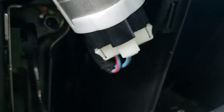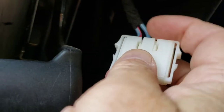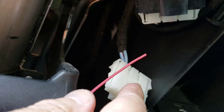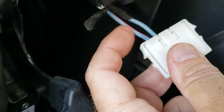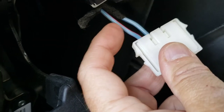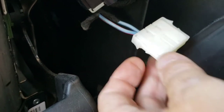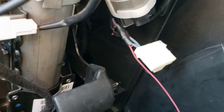For the ignition I have to unclip it. I'm looking for two wires — a blue wire and a blue-and-red wire. I need the blue-and-red; I need to solder this one onto it. The hardest part will be stripping this wire. I want to strip it just a little bit so I can solder the other wire on there. There's not much wire to work with and it's really tight in there. I got it — it wasn't pretty but I got it. Now I just plug this back in to the ignition.